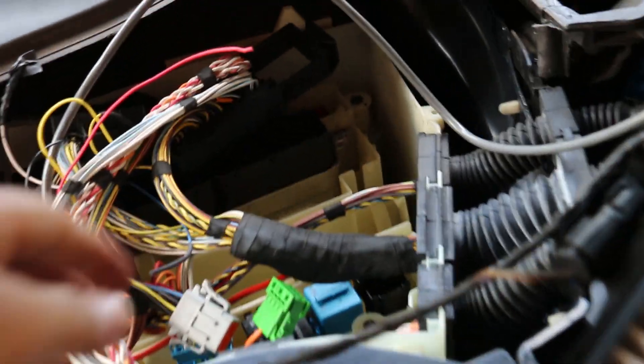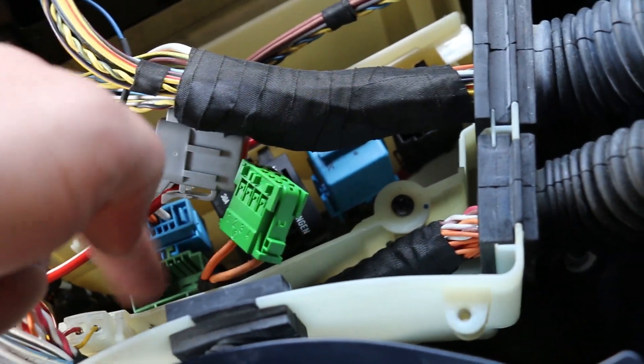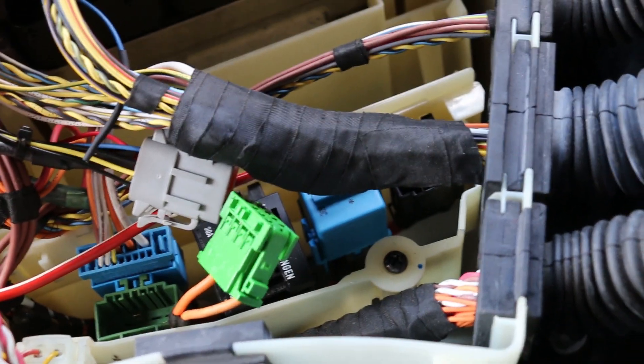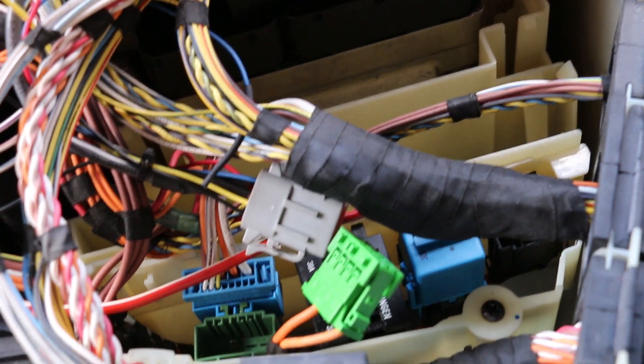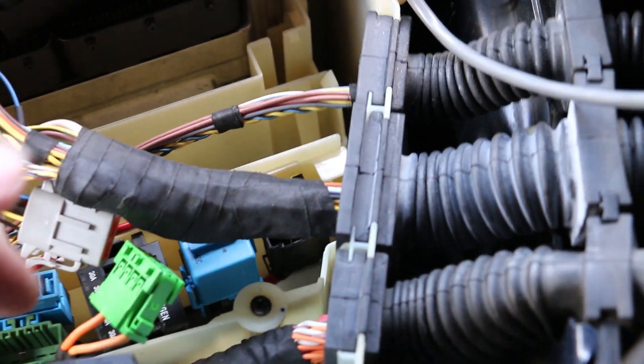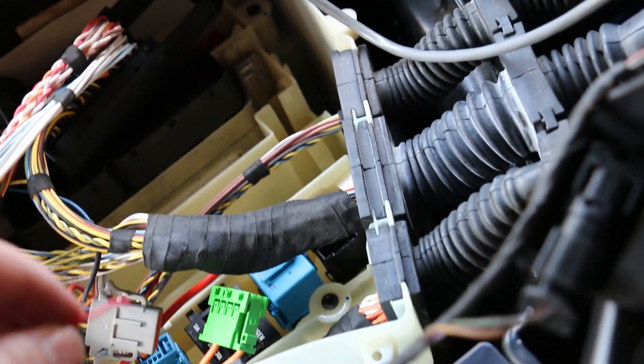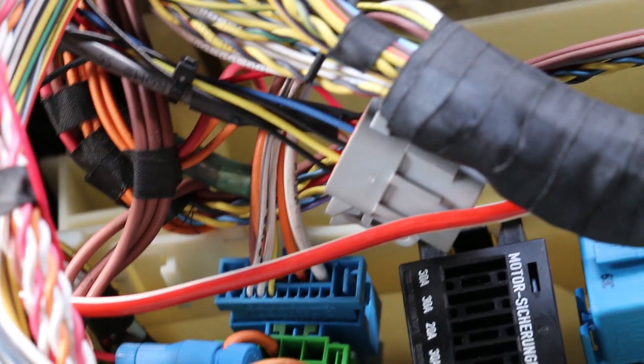The next part of the instructions calls for this green harness with two orange wires to be tapped into for a 12-volt power supply. On the E60s, it's very tough to get the bottom connector up and out because the wires are so much tighter. So although not fully recommended, I'm just going to be posi-tapping pin number two off of here, which connects to the 12-volt supply coming into the DME compartment. It's only not recommended because this connector could come loose and interrupt the 12-volt power supply to the flex fuel module. There's a link in the description on how to exactly set your posi-tap up. Grab off of pin two, plug pin two back in, and the red wire from the flex fuel harness will go into that 12-volt supply.